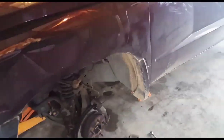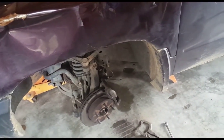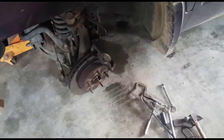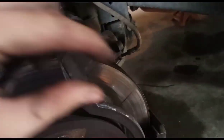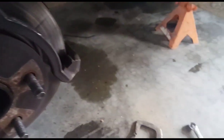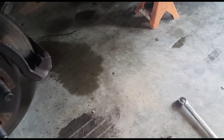Now that you have gotten the brake caliper off, you want to take it and put it in a secure spot where there's no stress on the brake line itself, so that way you're not risking tearing that brake line and having to buy a new one. Now, I'm having to replace rotors and brake pads. If brake pads is all you're looking to replace, then this is as far as you have to go. On the Dakota, it has slots here with little pins that slide onto the little tabs on the brake pads and it literally just pops into place. Then what I always do is take a pair of C-clamps, take one of my old brake pads, and compress the pistons back in so you can slide it over those new thick pads.